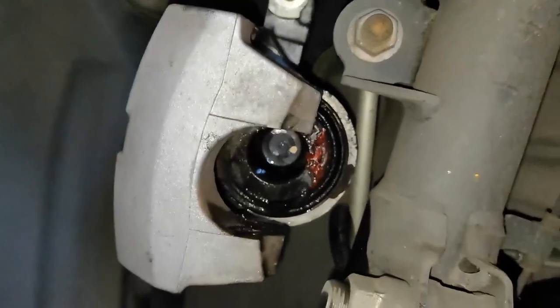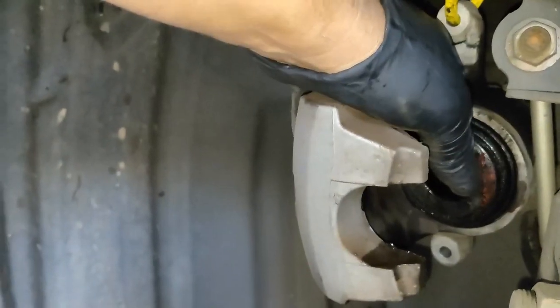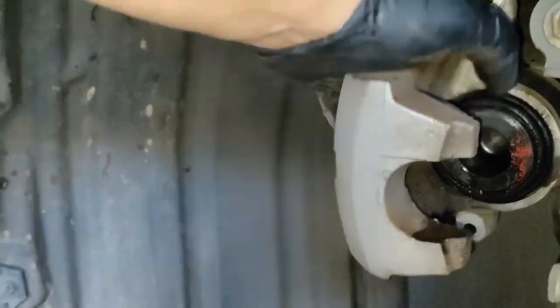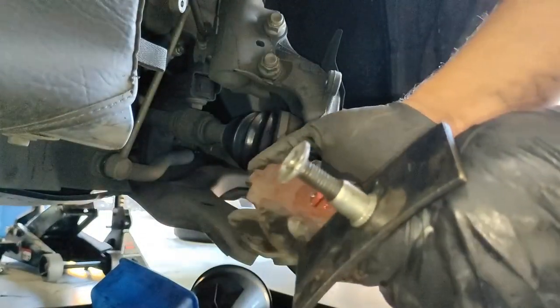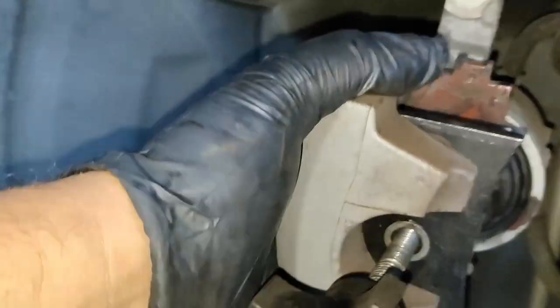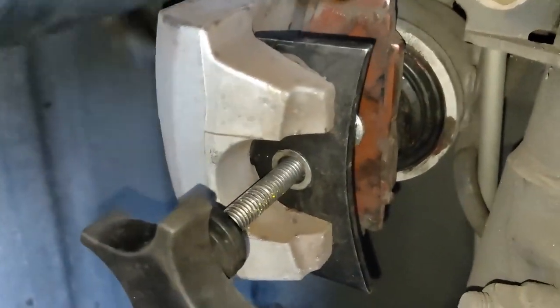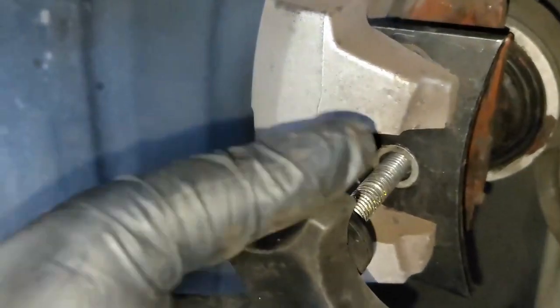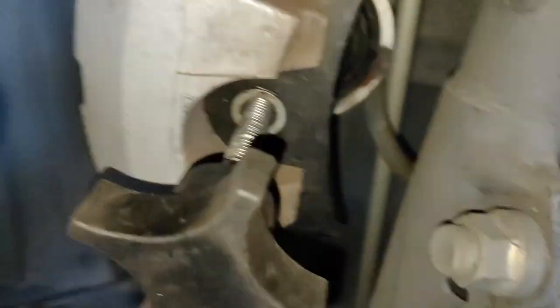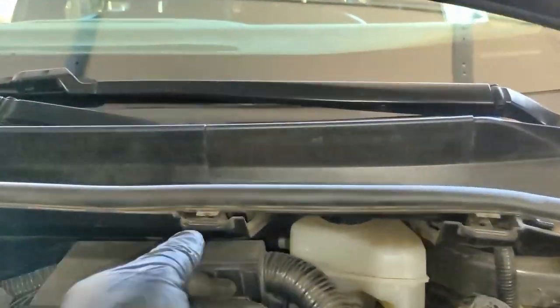The brake rotor is off. Now grab your wire brush and brush the front of the hub so we get a nice clean surface. Grab the brake cleaner and clean the front of the hub off. You can see that red gunk on the back of the piston — make sure you remove all of that before reinstalling. Now I'm going to compress the piston back using one of these five dollar tools, sliding in an old brake pad against the piston.